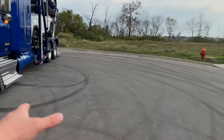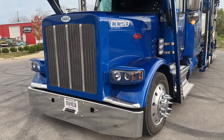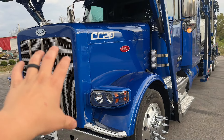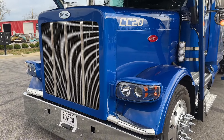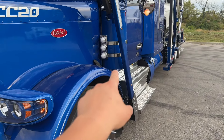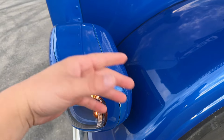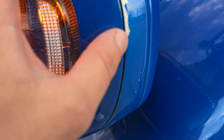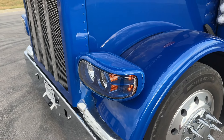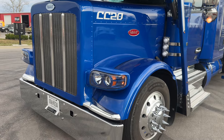We're back. So we had a few issues getting this front end wrapped. The paint job that was done on these headlights, on this grill, on the tanks, on these side tanks, was very bad. It peeled on this section. This peeled right here today actually because it's just not holding on to the chrome. It seems like they did a very bad job sanding them — they used no primer at all. They just put base color down and it's peeled off.